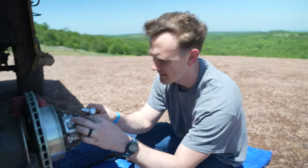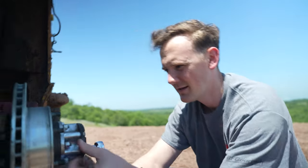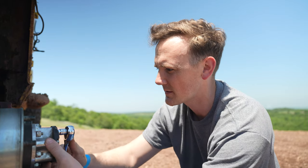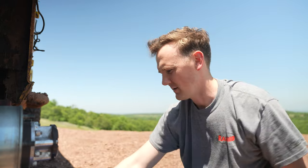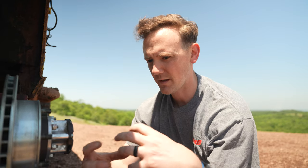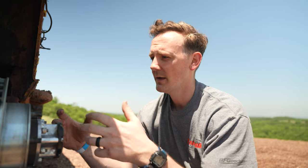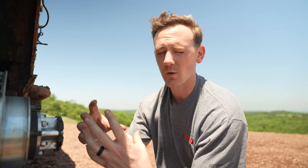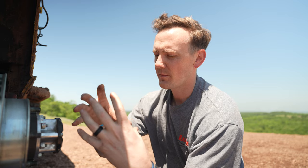Now we've had a few bumps and bruises. So, explain to us — for the viewers at home, what is happening right now? I think what has happened is the birfield joints — these are Toyota axles, so they've got what's called a birfield. Basically, the axle shaft attaches at that birfield joint. Like on the newer Jeeps, they have a U-joint in here that allows the axle to turn. This is a big bell, and inside there's the birfield — it's a big ball with the axle shaft inside. And that broke. I think that's a pretty common failure on Toyotas for the birfields to break.